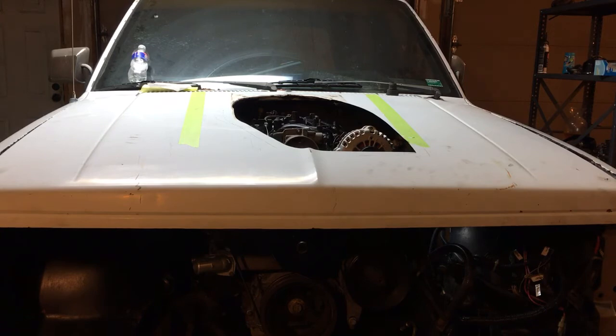What I've done is just shim it as far as I could to raise the rear of the transmission but maintain enough clearance where it's not going to rub the floor pan. I don't want it rubbing the tunnel because that causes weird vibrations and ugly noises. Basically, once I get this thing done, I can take it up to Certified, put the angle meter on it and find out where I'm at. Because I had it shimmed maybe not more than a half inch before, but now that I've moved the engine forward, I've got a lot more room to play with back there.